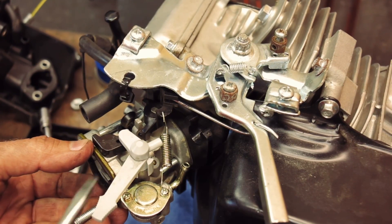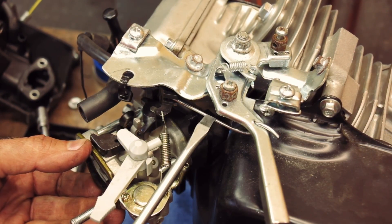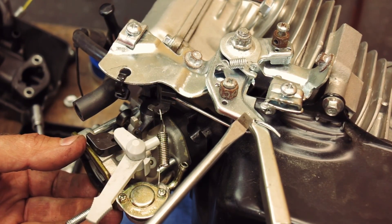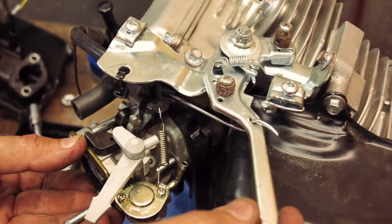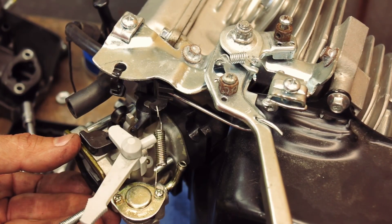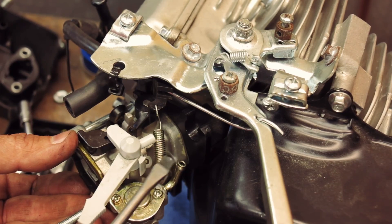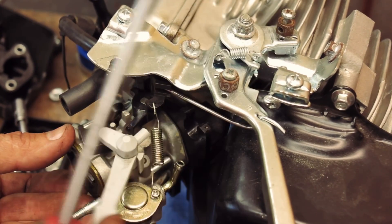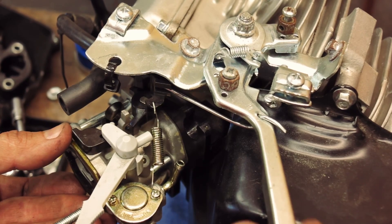There are a lot of different ways to do it, but I took the original throttle rod, pulled off the governor, re-bent it, and drilled the hole up here — looks like it should work pretty well. I've got a really good spring return: one up here and on the throttle flap itself I modified one of the original springs to come around and clear the choke. I think it should be just fine.